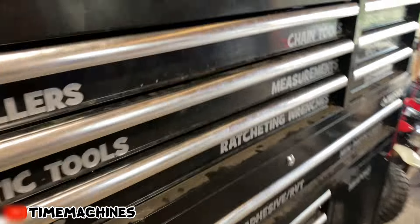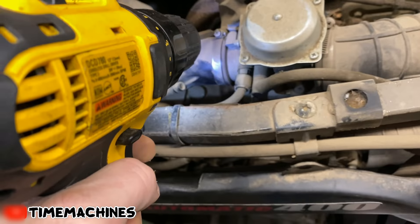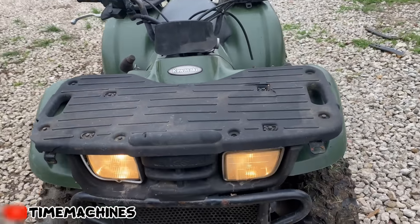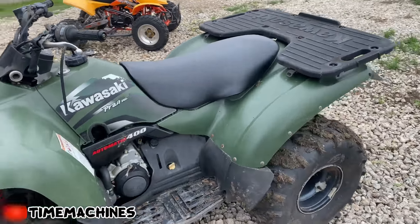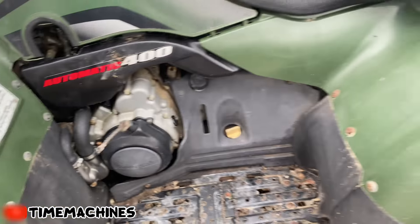I'm going to remove this carb. You got an intake here, and you got a couple over here - as you guys can see, this thing's running great. If you want to see how I clean the carburetor, check at the end of this video - there'll be a link. To recap: first thing, get the neutral light going whether it's a jump or whatever. Don't throw your back out trying to pull-start something that has a bad neutral safety switch. Second, put some power on the battery if it's dead.